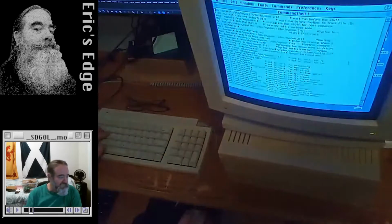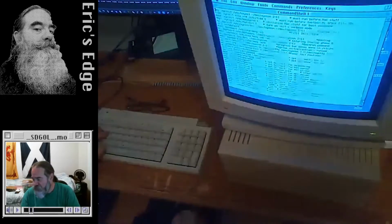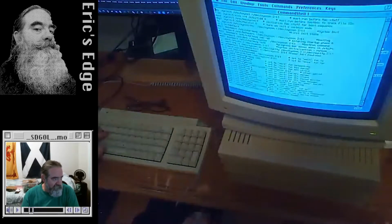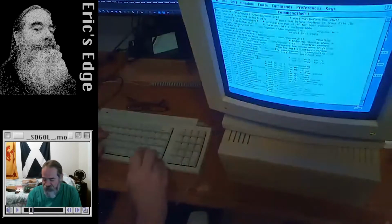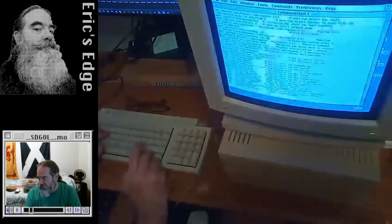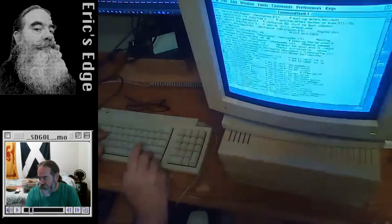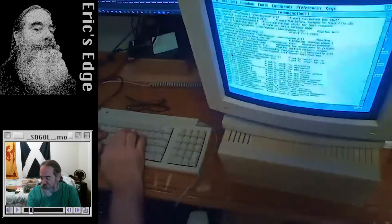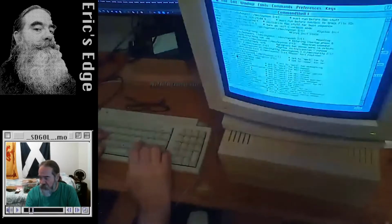Okay. So we need to find the NFS0, the portmap. This needs to be set to wait instead of off. And I already forgot I'm in vi. So, XXX, I for insert, wait. Okay.